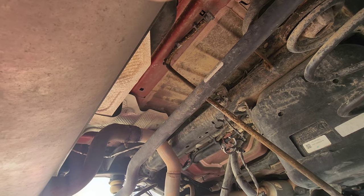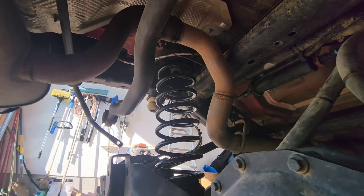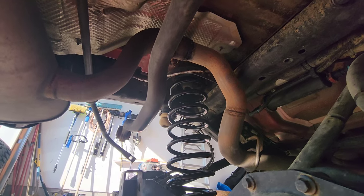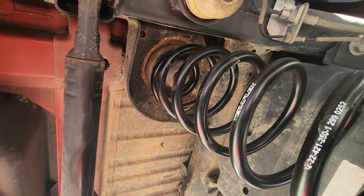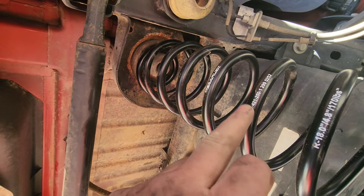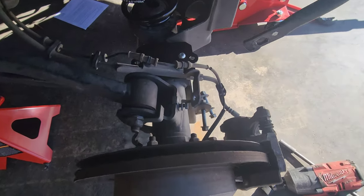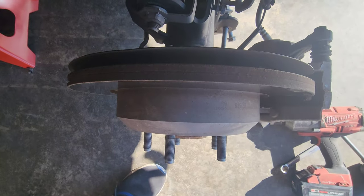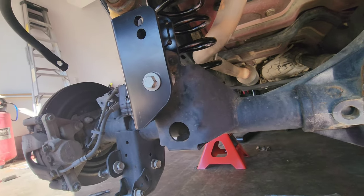She's loose — that bolt just pushed down on it, pull it up to the top side so it'll hang up when you lower it down. Lower it down — springs are completely loose. I've got the vacuum line right at the point of no return so I'm gonna leave it right there. Hard to record and show you how to put a spring in but it's not too hard, though it's a pain with one person — two people would be great, my son's at school. The isolators pop down a little bit, kind of a bugger to get back in with the spring but not too bad. Make sure you put the right spring on the right side — part numbers are all labeled, it's good quality stuff. Next, install your bump stops — make sure these holes are to the outside of the Jeep. Pretty simple, 6 millimeter, 14 on the other side.